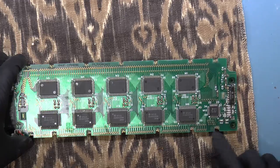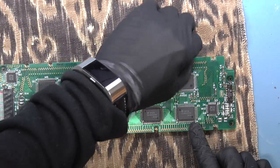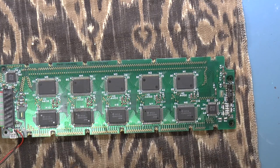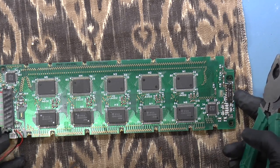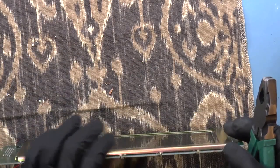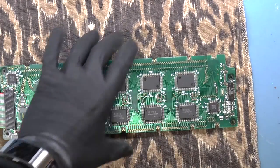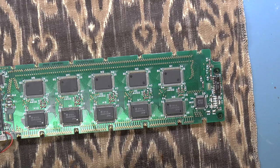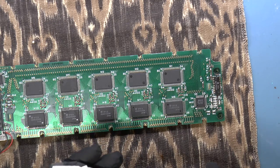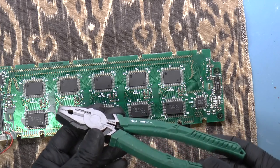Right, so in order to take the LCD off, I'm going to have to twist these bits of metal. And I hate twisting the metal because that always means that you're going to add fatigue to the metal. And fatiguing the metal means that you always have the possibility of breaking one of these tabs off, and then you're not going to get nice compression on that elastomeric strip, which kind of ruins everybody's day. So I'm going to use this, the Negisaurus Engineer.